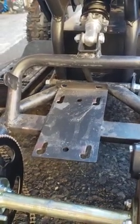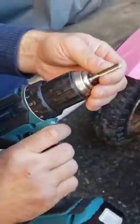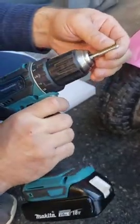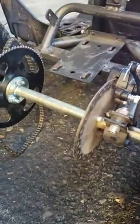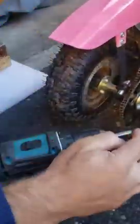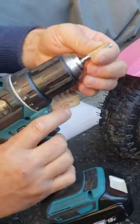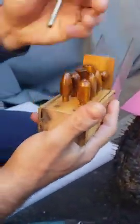I did this with a tool called a metal burr. This burr does a great job of grinding or cutting metal sideways. I just used the burr and basically drilled it on the side. If you don't have this tool, you can use a regular drill bit — it will just take much longer. This tool lets you modify all six holes in literally five minutes. You can buy them separately for about five to ten dollars each at Home Depot, eBay, or Amazon. They come in different shapes, so you can choose whatever you need for the job.